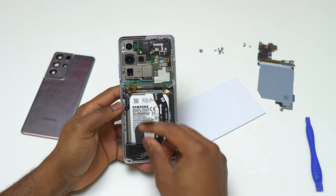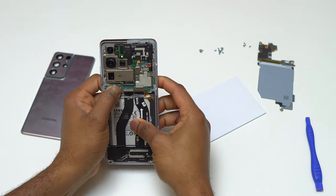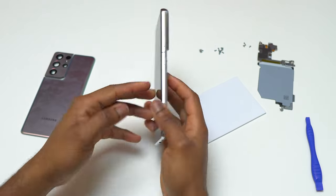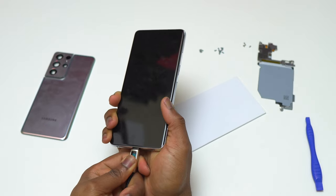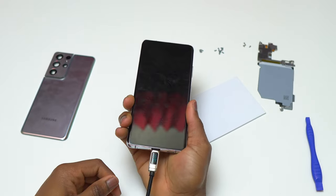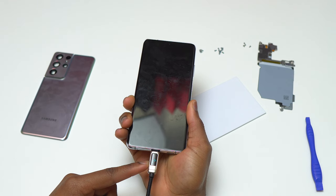After disconnecting the battery, I disconnected the screen flex cable — that is the big cable in the middle of the motherboard. After that I applied some pressure on all the other flex cables connected to the motherboard, then I grabbed my charger and plugged the device in. I can see on the charger that the device is getting charged — it was getting 10 watts of charge rate — but the screen is still not responding.